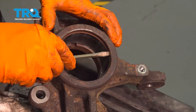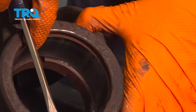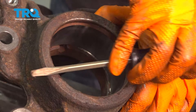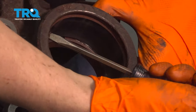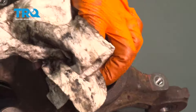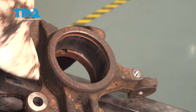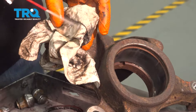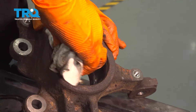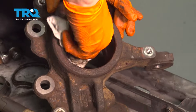I want to clean out the groove where the snap ring sits so it can seat itself properly — this is basically the only thing other than pressure holding your wheel bearing in. Take a screwdriver and scrape off everything in there, use a rag to wipe it, then put some brake parts cleaner on a rag and wipe off any oils, debris, or anything stuck on there. Clean up the rest of the surface — that should be ready for install.